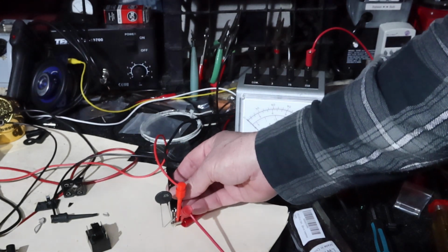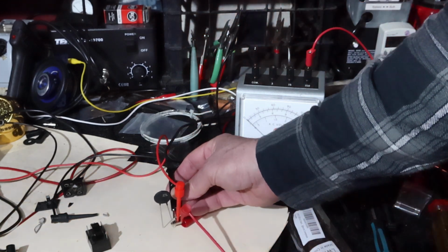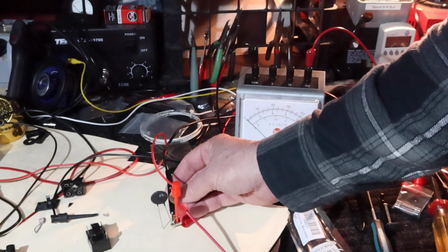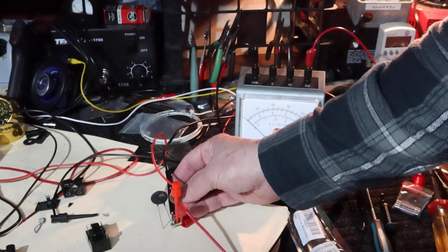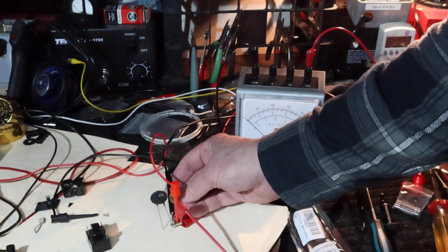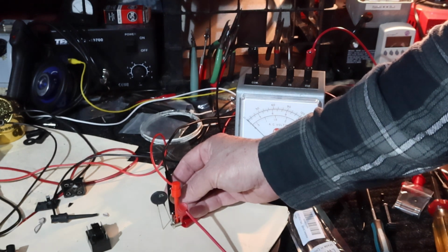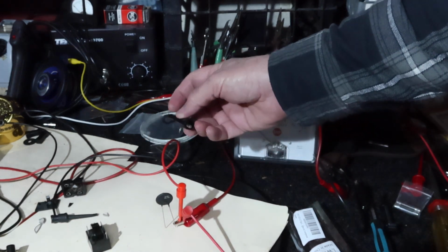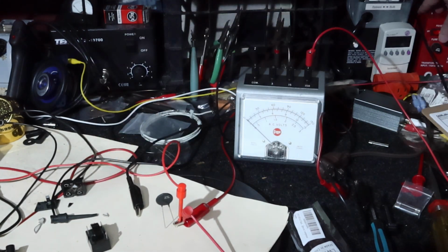And so we get a spark, and that bulb lights up back there in the back top right, if you see there. Okay, so that's limiting the current going through here. If this had been a short, that's limiting it to, I think it's about 1.5 amps or so. It's 1.8 amps. It's 150 watts. Otherwise, I could be getting 15 amps through that. Okay, so let me turn this off again.